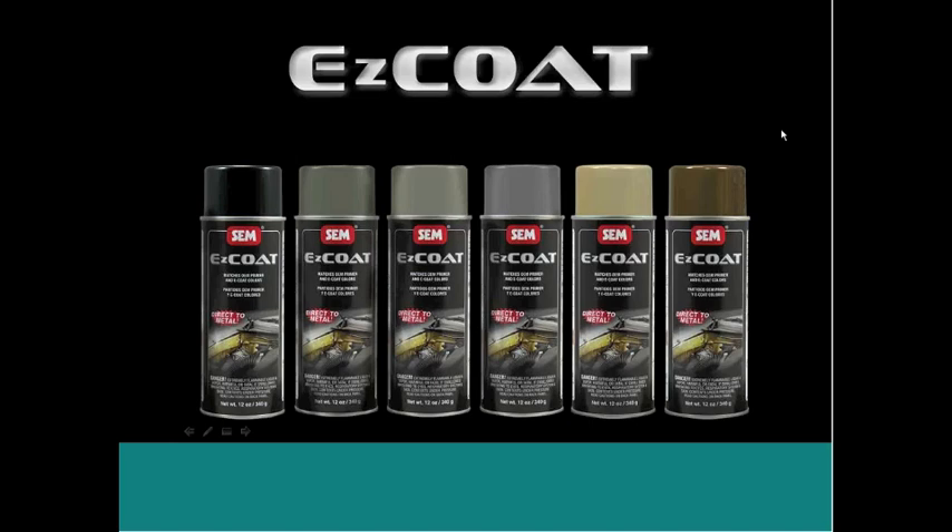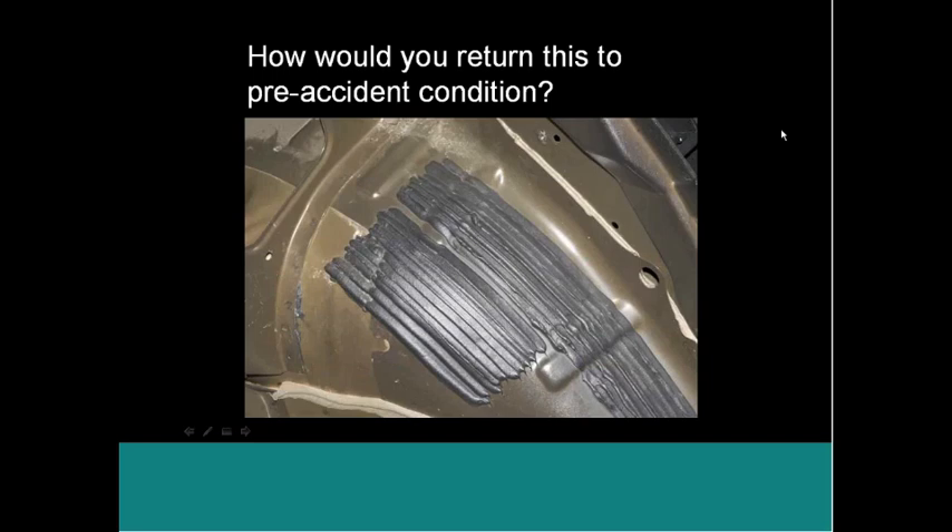Just to give you a little better idea, this picture right here is the inside of a fender well in the trunk area of a vehicle. The slide asks how would you return this to pre-accident condition? One of the things we often like to mention is we talk about that self-etched green primer. Obviously, the color you see there is not green, and self-etched primer is not available in brown. If a customer or the shop wanted to mix up base coat to match that — which is what they've been having to do — the base coat isn't designed to go directly to bare metal. So the tech would have to mix up primer first and then apply base coat on top of it. You're looking at a long process to put this color back like it was intended.